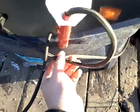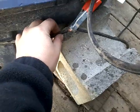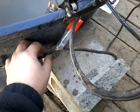Let's see if I can show you. I took the wire here and I spliced another wire into it. That wire runs around, comes over here, and did the same exact thing on this side. Then I stripped the wire down in the middle — you see right there — that's where I hook up my positive from my battery charger.